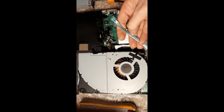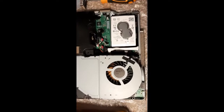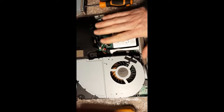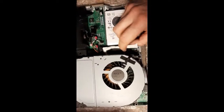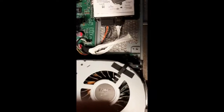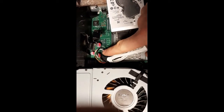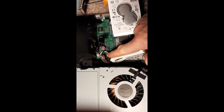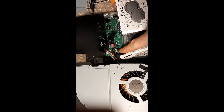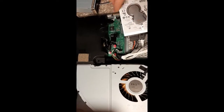I'm down to just the two wires inside, and I've used a bit of electrical tape to put it back together. I'm a little impatient so I'll probably buy a proper SATA lead to get it in neatly without obstructing airflow. For the power, I took a normal SATA power lead — you can see I've reconnected it in there. The two reds are in the center terminals, and those connect to these two pins which are shorted together — both the same. Then there are the two ground pins at zero volts.